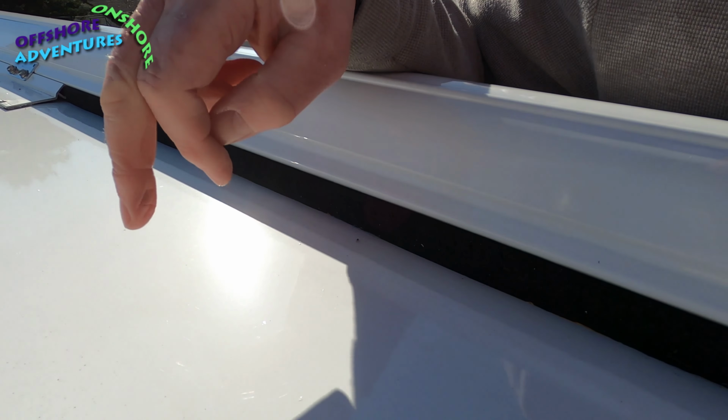So we've now got left the winding handle, this one, and then this bit, that's the extra rafter that's supplied for this one, because it's 4.25 meters. They supply the extra rafter, which once the awning is fully out, clips into the middle of the awning from the van to the furthest point out, and it's got this little screw here which allows you to extend it. It's telescopic, so you extend it, get it clipped in, and then tighten down this so that the rafter stays in position.